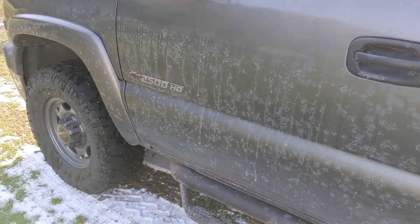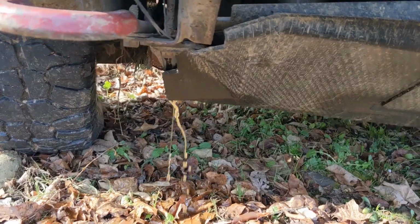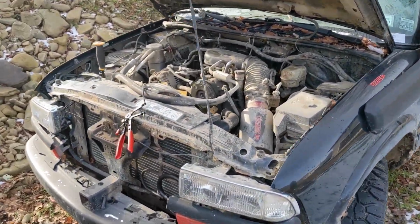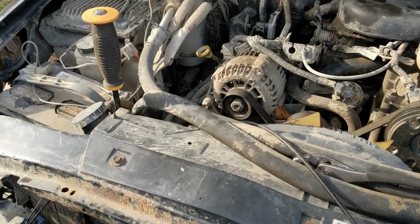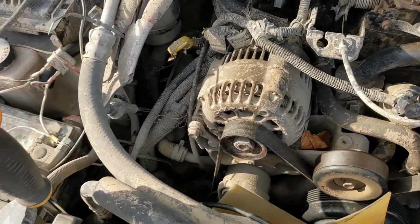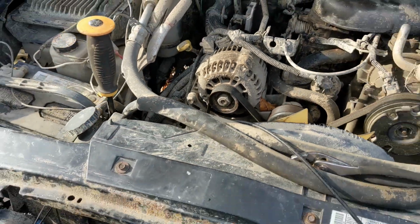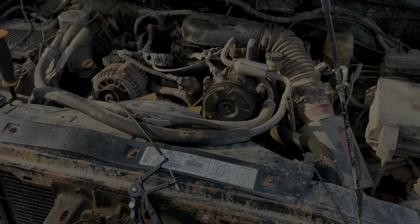Why am I wasting my time on that winter beater Blazer? This is why. I hate salt. Well, it is still liquid. That's a good sign. I sort of totally forgot about the old shit box here and remembered that I did fill this up with water after I pissed out half the coolant overheating at the Gambler there. But if it's coming out water, it should mean the block's not cracked and I'm all right.